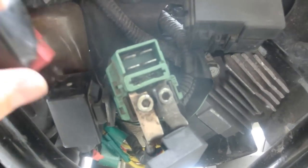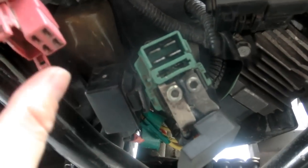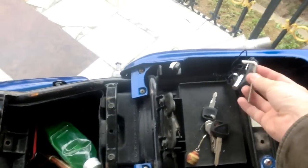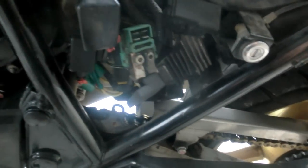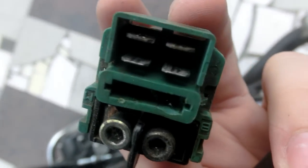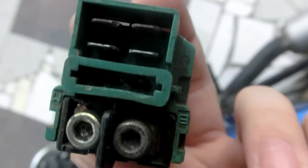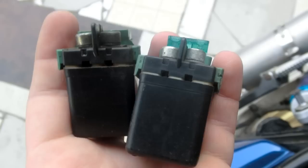Before I rewire everything, I have to test if the new relay actually works since it is a secondhand part — I have no idea. So what I'm going to do is plug it straight into the current wires and see what happens, see if the bike starts. I need a four millimeter Allen key to remove these wires. I'd just like to show you a comparison between the two. Here's the new one — secondhand new one. Here's the old one. I've already cleaned this old one up a lot; around the terminals here it was heavily corroded, there was all sorts of rust and nonsense going on there. That's it — time to put the new one in and see how it works.